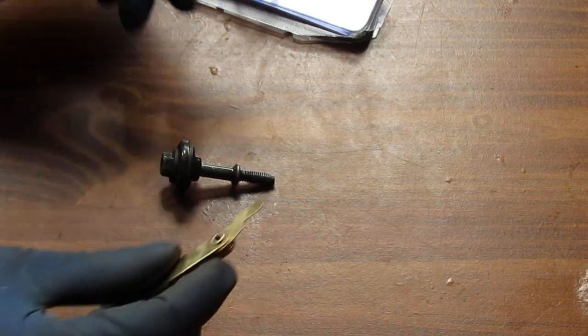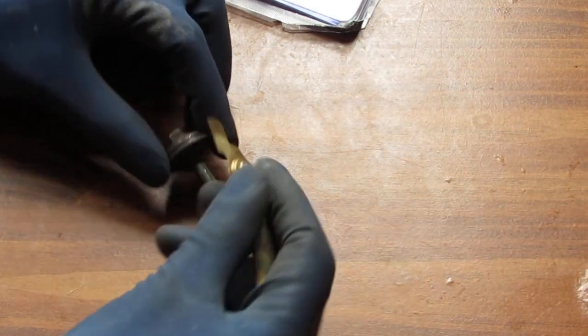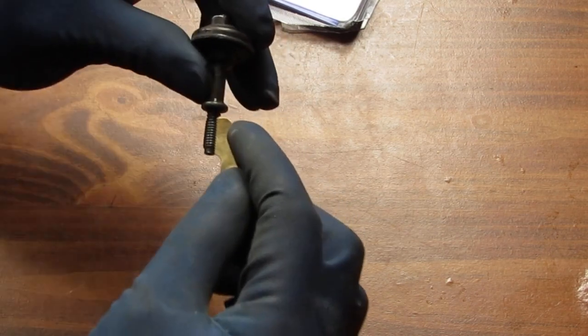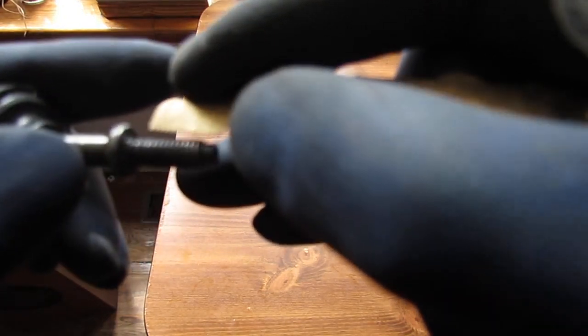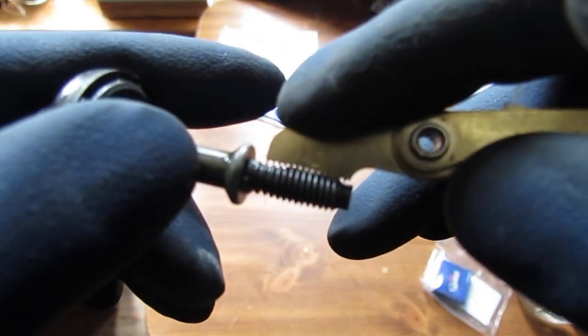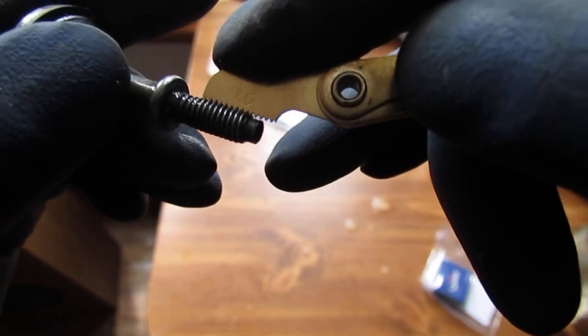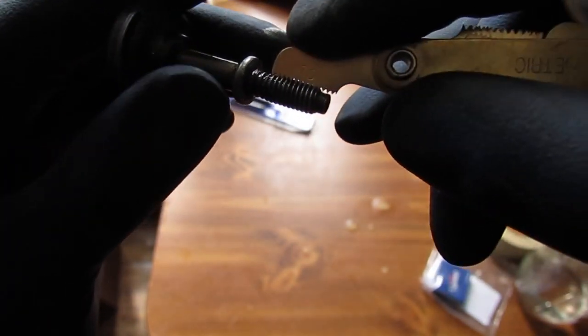So you would find your 1.0 like that. That's what it says right here. It might be a little hard to see. Okay, and you go like this, and you're looking for a seamless fit. Now that is seamless, right? Back out. Okay. This is seamless. You've seen me do it before in other videos if you've watched, but that's what you're looking for. See how that just matches all the grooves seamlessly? Okay, so you know it's a 1.0.